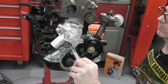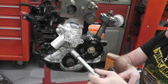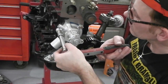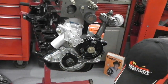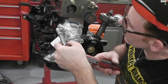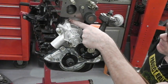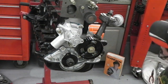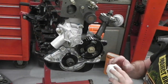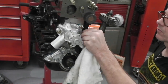So that's the water pump. We're gonna go round these, we marked them up that they all need torquing exactly. Never had a problem with any water pump I've ever changed, ever leaking. No reason why anything should change if this is right or wrong. A little bit of the blue squidging out, that might be room for improvement on that perhaps, I suppose. You know, maybe there's a technique for that, which I don't know about. However, I'd feel happier with a sealant on it because it's the water pump.